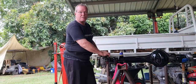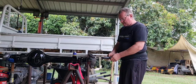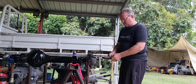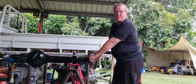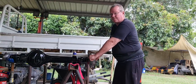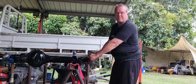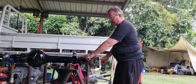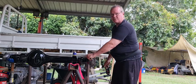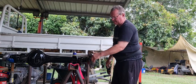I'm now running a 0.2mm shim top and bottom. That's about where I want it. I've seen some where they want you to go 9, even as far as 15 — guarantee you at 15 you'd feel it being notchy, it's just way too tight. Even there, that's pretty good — a little bit of effort to move. I'm gonna leave it at that.